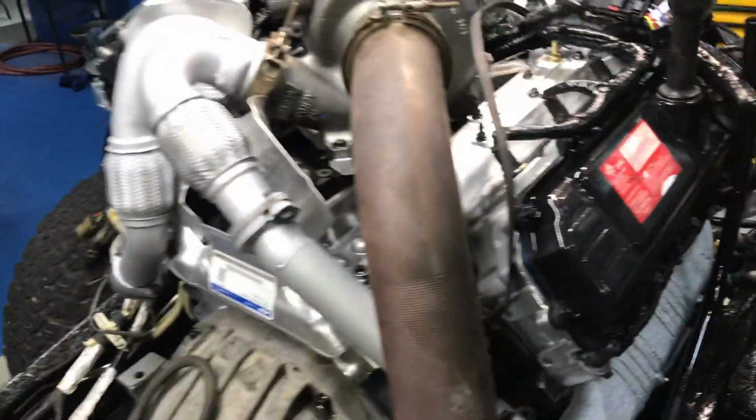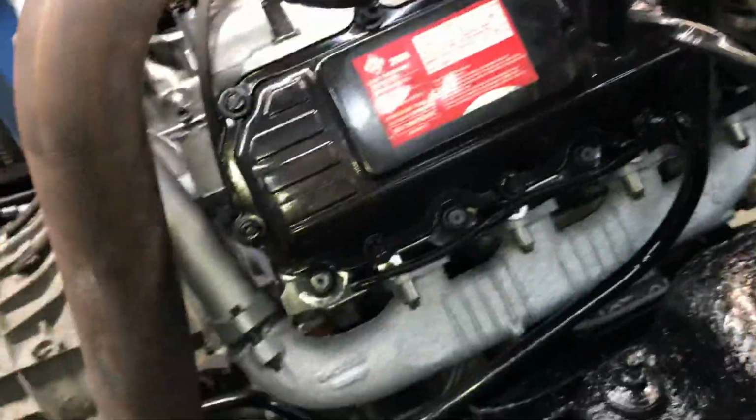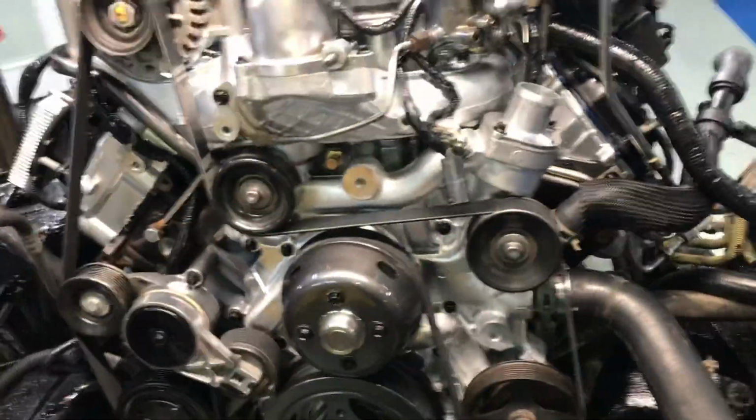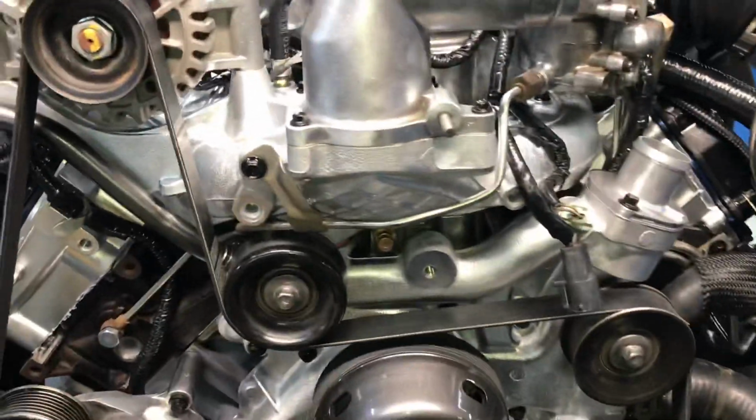Got our Y pipe intake. We basically did heads off, engine out. Did not separate the bed plate. Put lifters in it though. And total, mostly oil reseal except the bed plate. Front and rear covers, all that got redone.